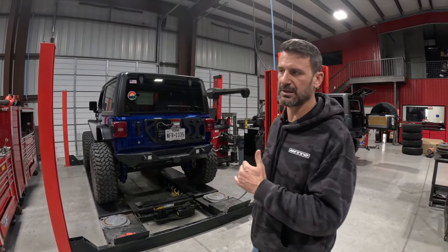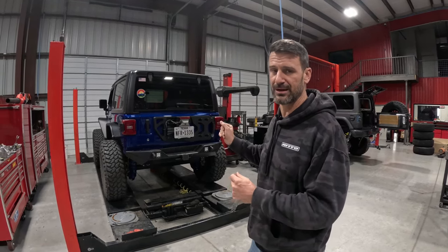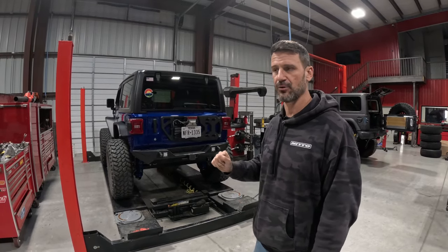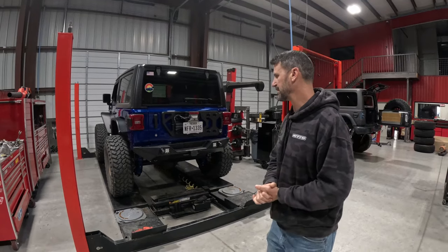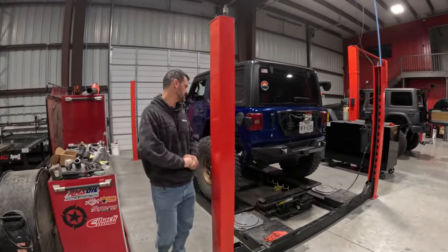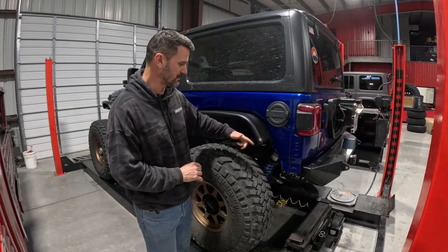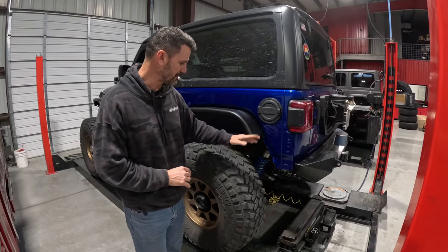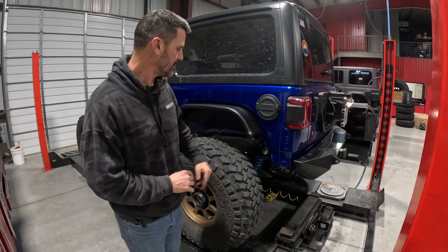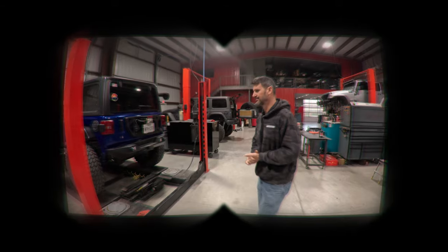It's got Evo bolt-on coil overs in the front, Evo long arm kit in the front, Evo bolt-on coil overs in the rear, and a really cool single triangulation setup — not stretched — in the rear, with Evo brackets, Evo truss, and I think those are Fusion axles. Jacob flexed it out and we had him trim the metal cloak fenders because rear steer is kind of a thing you still get with single triangulation. As the tire came up it was really getting in there, so we cut the fender back and Jacob re-welded it. We had it powder coated, came back in today and bolted them up. It looks great — we're going to put the inner liners in. I think tomorrow I'm going to take it out for a little off-road test. So far it drives great on the highway — it's pretty fun to drive.